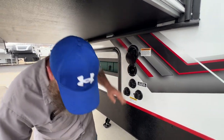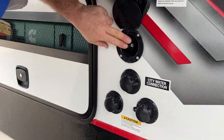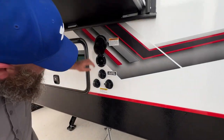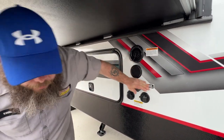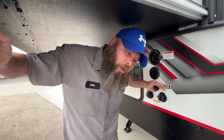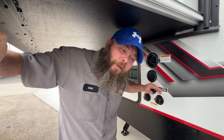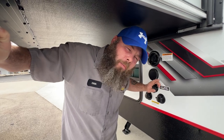Next, you have an outside spray port area. You've got these two notches that go right in — press firmly and twist to lock it into place, and then you've got your outside sprayer options. Next is your city water connection hookup. You always want to make sure you use a pressure regulator, then an inline water filter, and then your white drinking water hose. Hook up here and you're ready to use the water system right away on the cold side. You do have to wait for the water heater to fill up before you can get hot water, and then you have to turn it on to heat that water.